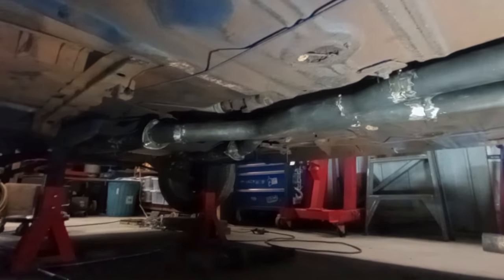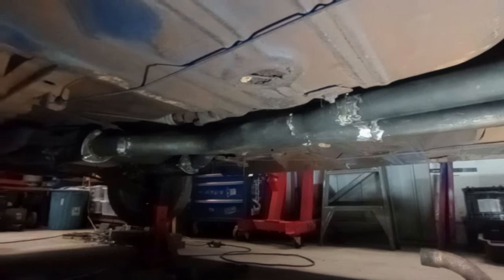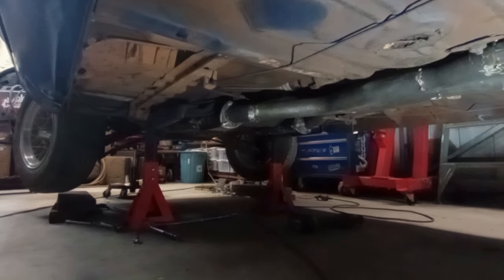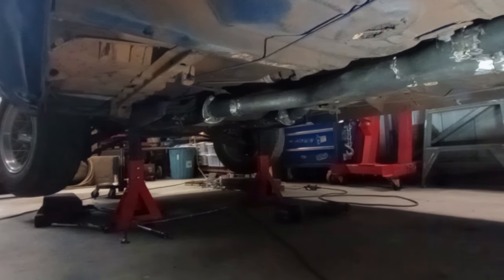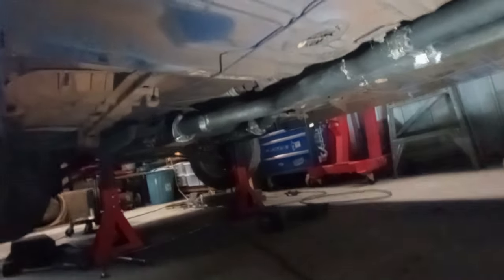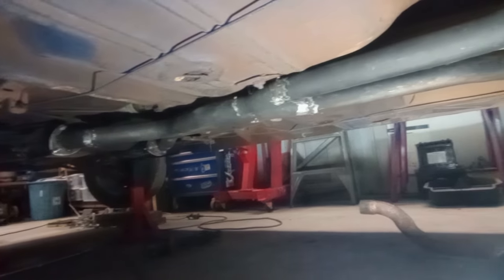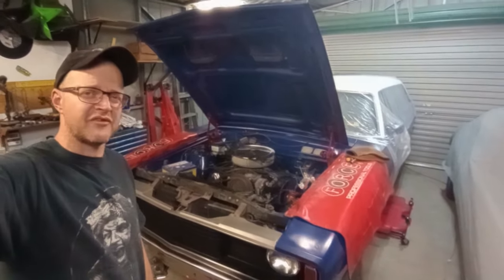It's taking shape and I just need to finesse it, but that's going to have to be the subject of the next episode because this has taken me quite some time to get this far, and I need to pull those extractors out, weld them, fit the gaskets up so I get the correct clearances for those output flanges so that I can start welding all this up in place to figure out how much movement I'm going to get. So progress is being made slowly but surely, but that is enough for this episode because I'm out of time again. One final note before I do the summary for this episode.